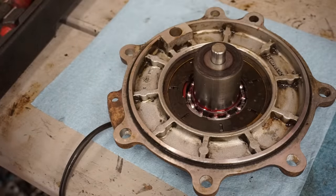And the smoke's starting to go away. I think it's just burning off the pipe carbon. So if you look at the pipe here, we'll rev it out a little bit. Smoke is completely gone. Just getting a little nervous there for a little bit. But it was either the valve seals or the piston rings, and we replaced both, so we took care of it. No longer a smoky quad.